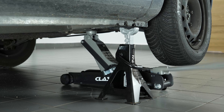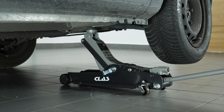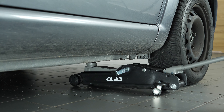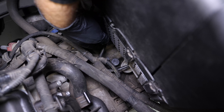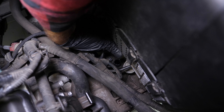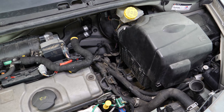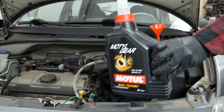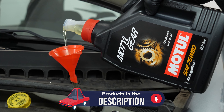It is now time to refill the oil in the gearbox. You have to be very careful and precise when doing this part of the job. Firstly, put the crankcase cover back in place, then lower your car back to the ground and check the oil level — this can only be done when the vehicle is flat. Disassemble the various components to access the gearbox oil breather. For refilling, reuse the funnel and plastic tube used for adding the transmission fluid cleaner. Insert it all in the filler hole and add the oil intermittently due to the diameter of the tube. You can find the exact amount of oil suggested for your car in the description of the tutorial.